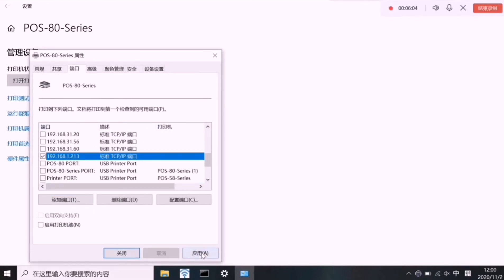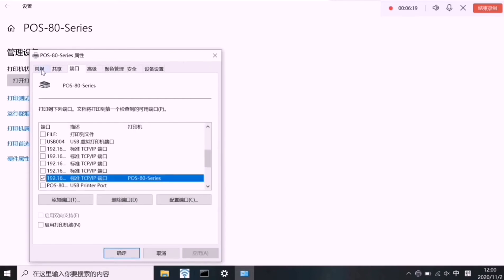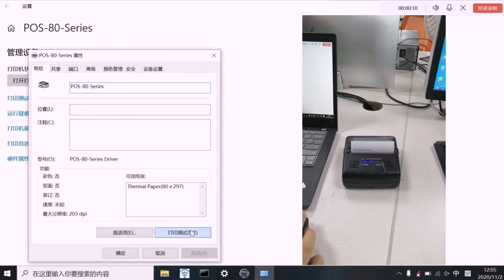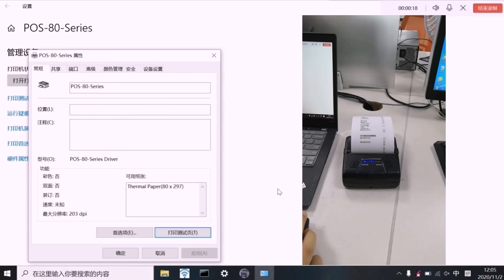Find the port we just added and click Apply. To confirm the IP address is available, press Windows and R, type CMD, and ping this IP address. Press Enter. When all the ping replies come back with no problem, remove the USB cable and try to print by Wi-Fi — it's printing! The Wi-Fi setup is successful.